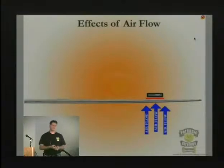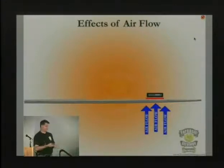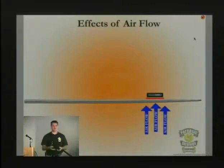And you would have 24-inch platters, and there could be 50 of them in one hard drive. When one went bad, it was extremely costly and extremely difficult to get in and replace one and get it running. So through an anomaly, one of the guys figured out that when the platters are spinning fast enough, if you took some of the weight off of the head, it would actually float over the platter. By 1963, they switched over to a head that floats over the platter, and it's never gone back since, because it eliminates that whole wear and tear that would happen on the drive.